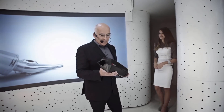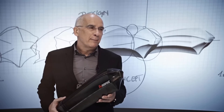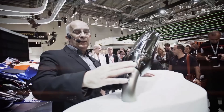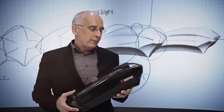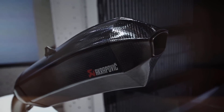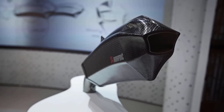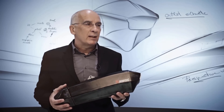Today we are presenting the new so-called evolution — this is the new shape which we think can really suit the demands of further development in our company and will fit on most new sport bikes. The shape is quite modern and organic, but we also improved the performance. The outlet of the muffler, which you see, is improved for flow and brings about four percent better flow compared to the old one. The sleeve is also a little different — it's bent and has more radius, which makes it much more rigid.